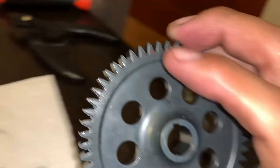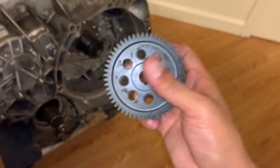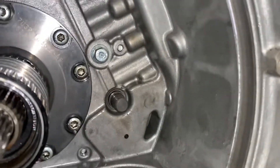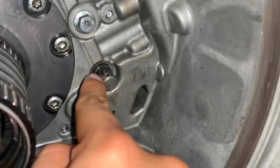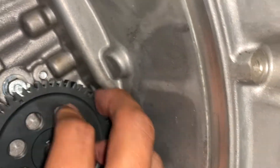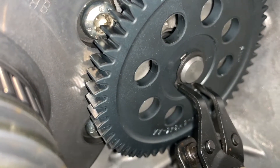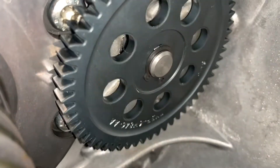So now we're going to put this gear in. When we put it in there, we're not going to put it like this — we're going to put it facing this way, with this groove right here facing outward. So now you have to find where the little — you see it's right here? And that's where you're going to line this right here. So you see you have this little lip right here, and that's where this ring will go. And you spread it out — like so.